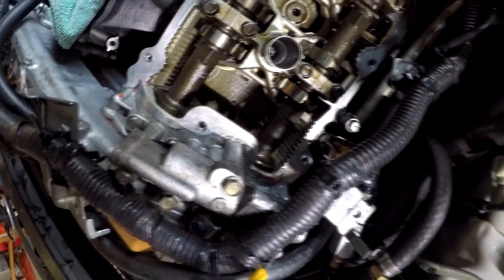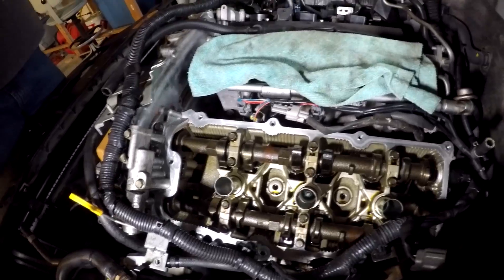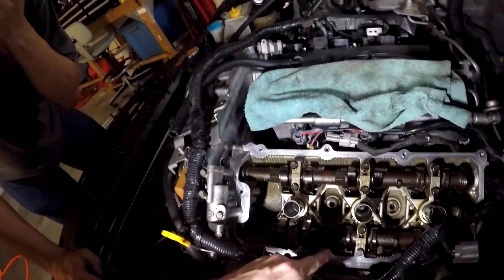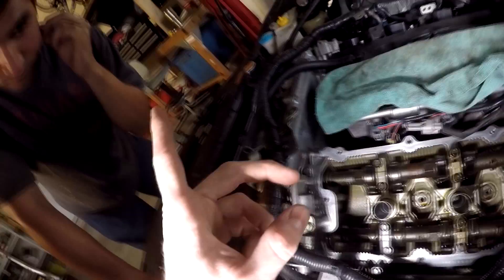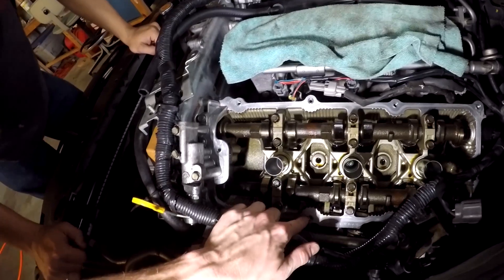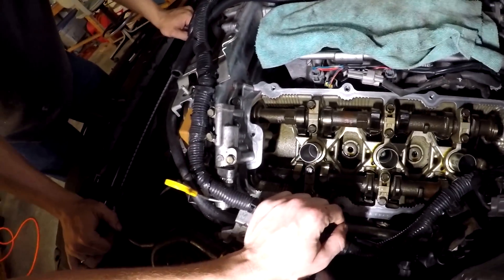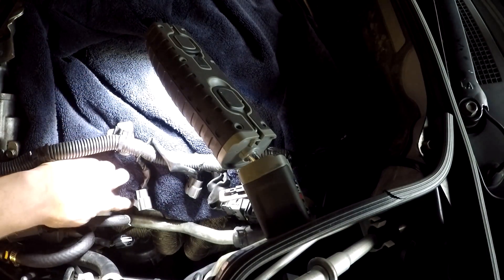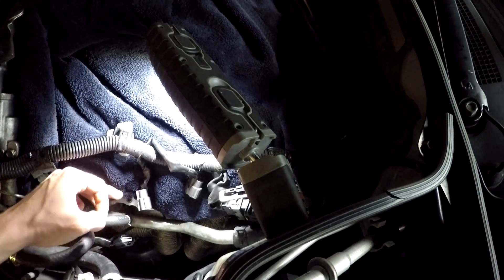A little paper towel — I'm just gonna go ahead and wipe off all the excess grime and RTV that is on top of there, the oil and whatnot. This way we can have a nice surface between that and the gasket. I already cleaned off the surface. We gotta start drilling into these two holes right here. What we gotta do is probably put something on this side so that the shavings don't go in there. Using a little bit of oil on the drill bit will pretty much help the shavings start sticking to the drill bit instead of flying out and into the engine, which is not good. We're gonna take some oil and pop it right over the hole there. It'll help with catching a little bit of shavings, but this is why we have the towel here to catch most of the shavings.